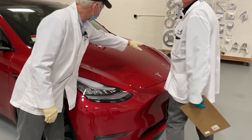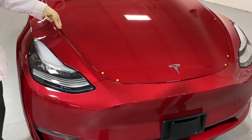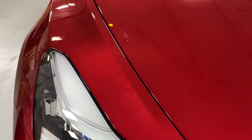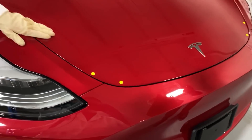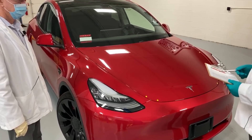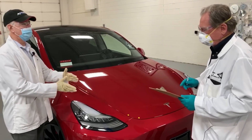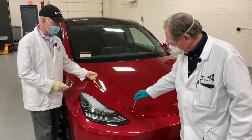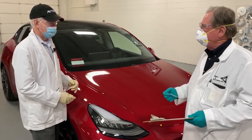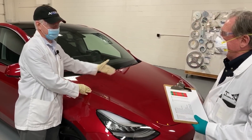Can you explain these little yellow dots that you've put around the car? That's how we determine whether or not there are flaws. So this is a gap gauge, and this is what we use to check the whole car. What we found was that here on the hood, we were running gaps that were basically from one to three and a half, and three and a half to four and a half. If they would have been all the same, I would have been delighted. We put the gap gauge in, we measure where it says, put the number down, and then look from left to right. So you want each side to be exactly the same, and what you're finding is variation from one side to the other.